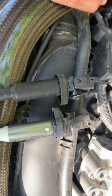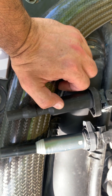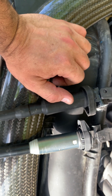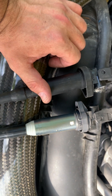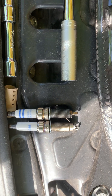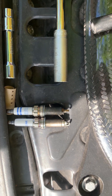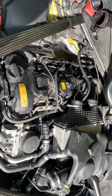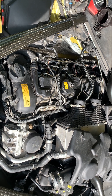Over time it can cause problems. The coil is not strong enough — it doesn't produce a strong spark, so you get weak combustion, especially at low RPMs. Your engine is not going to run well for sure, but it will not trigger a check engine light. This spark plug is definitely bad — I don't think it's original. It's just not worth it to save anything on these parts. It's going to cost you so much more — cheap people pay twice.